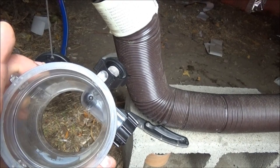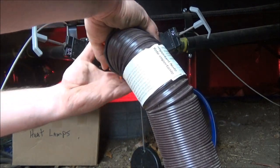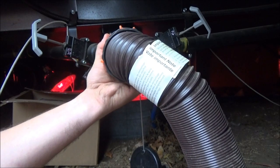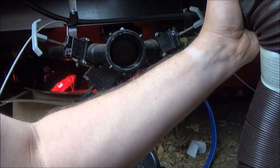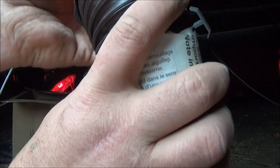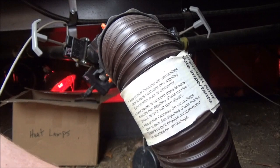We are going to install this today and hopefully not get sewage all over us — it's going to be nasty. I'm going to start by moving everything out of the way and go to disconnect this. We'll leave it angled up just in case there's something in there. Oh, a little bit of liquid — it's pretty clean actually. Now we'll get the new fitting on like this, nice and tight, move the hose so it's not crimped, and get it the way we need it.